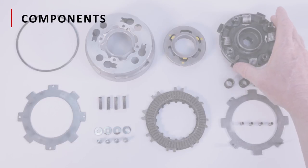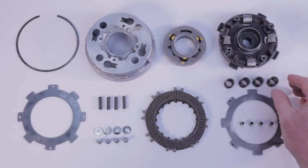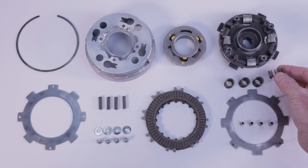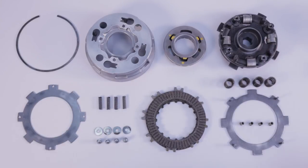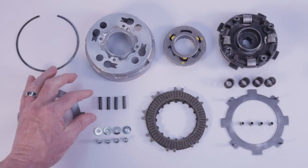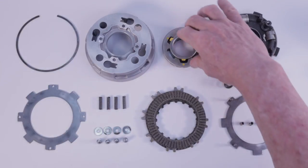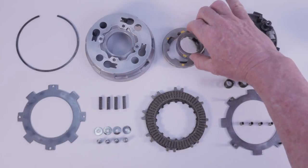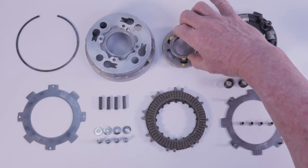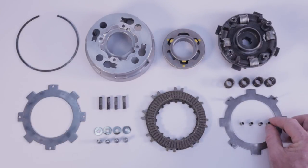Going roughly in the order of assembly, first we have the drive plate which houses the clutch weights. We have new clutch springs that go onto these bosses. The four screws and washers that fasten the drive plate to the clutch outer cover. Four damper springs. The clutch center, which inserts into the drive gear outer — I'll explain that in more detail in just a second. And clutch plate A, on which these free springs are held.